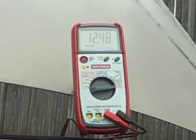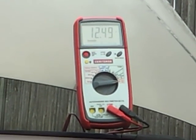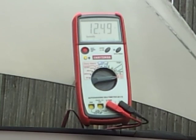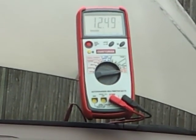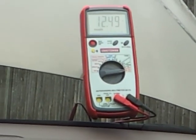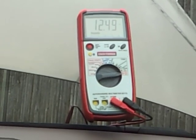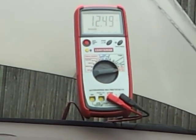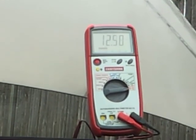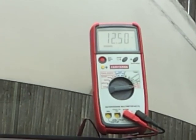If your radio goes on and you hear the bass go on and off, it could be the alternator. Or you have a misfire while driving, like your car is about to cut off and is bucking. In the morning your battery is dead, or your car shuts off while driving. You might also have electrical gremlins like door locks going off like the car is possessed.